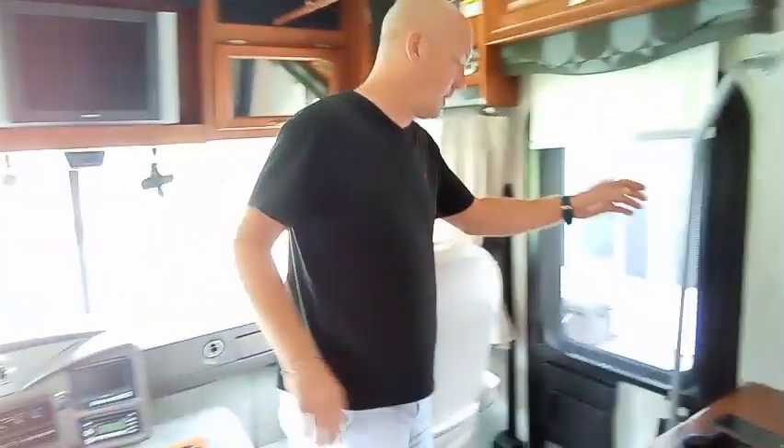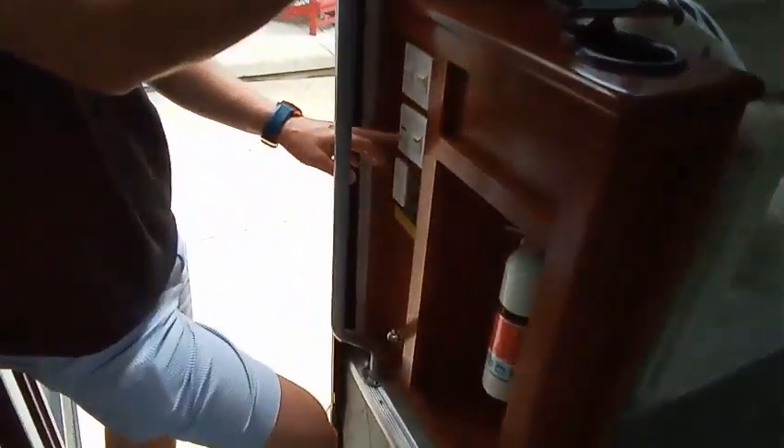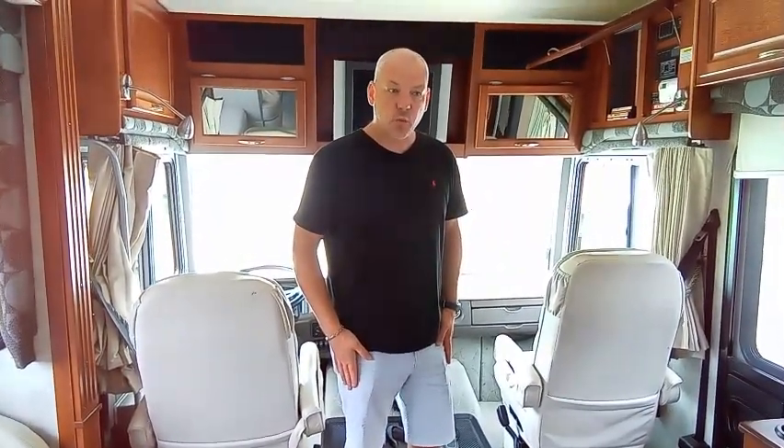Thanks for watching. You've done all the outside videos and know where everything goes. Assuming the outside is packed away, the first thing you're going to do is take an entire walk around the vehicle to make sure all the doors are closed — that is extremely important. The second step is to make sure the stairs retract using the entry step switch I showed you in the other video. Flip that down and the steps will retract. If they stay out and you start driving, it's very easy to tear them off.